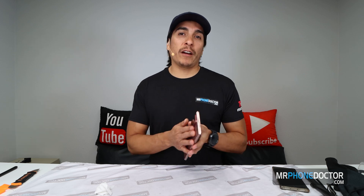So this is the actual Note 20 Ultra we're tearing down today. As you can see the back is broken — this one is using glass. Just like the higher-end S21, the Note 20 Ultra uses a glass back as well, so be extra careful because you can break the back glass. We're simply going to be using our heating plate to help soften the adhesives. We like to use 90 degrees Celsius. Once it's nice and toasty we can begin removing the back glass and then the internal components.